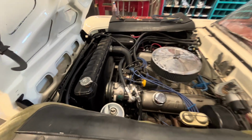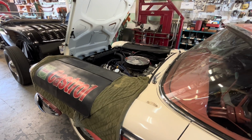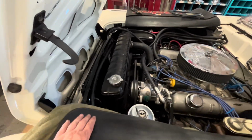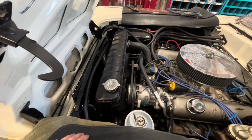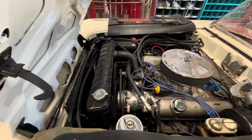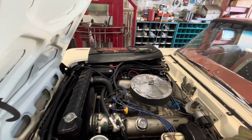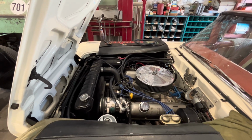Okay. Turn the air conditioning on and I'll see if the clutch works. No clutch. The clutch might not work because there's no pressure in it. That's what that little safety switch over there does. So Nigel will have to charge it first.